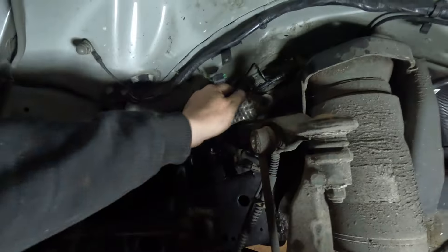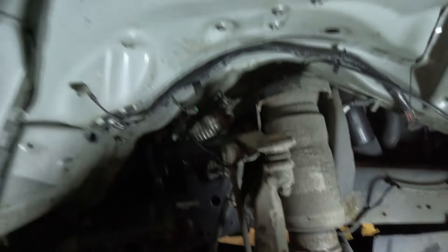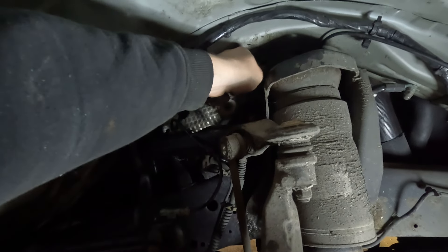To get the parts of the body off you've got to take all your wheel arch liners out, wheels off, wheel arch liners out. There's a couple of bits to unclip - the air pipes for the airbags and stuff like that on all four corners. Then undo your brake pipes because obviously they come to your brakes and they fasten to the body, so we've just put a little rubber bung over them to stop them leaking, otherwise there'll be fluid everywhere.